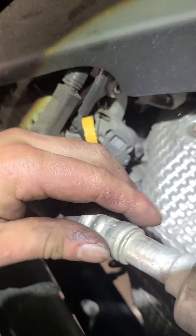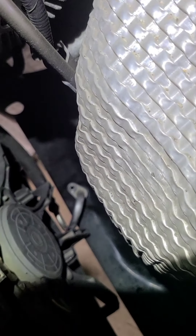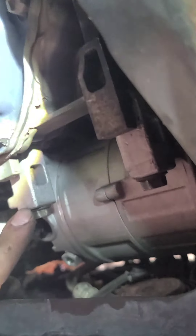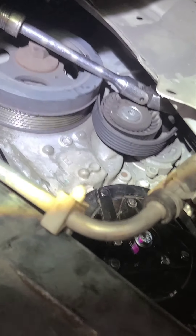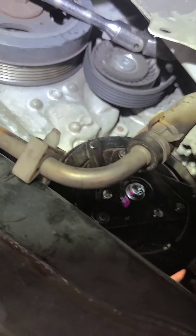On your lines you're gonna have these O-rings — I just took this one out to get it out of the way. We're gonna take this O-ring and replace it. Same thing with your line down there — there's an O-ring on it and you want to replace it. Find a suitable replacement. I got the two bottom bolts in and the belt off. Use a 17 millimeter and rotate it counterclockwise — it's a whole lot easier than using that T45 — and just like that your belt will slap right on.